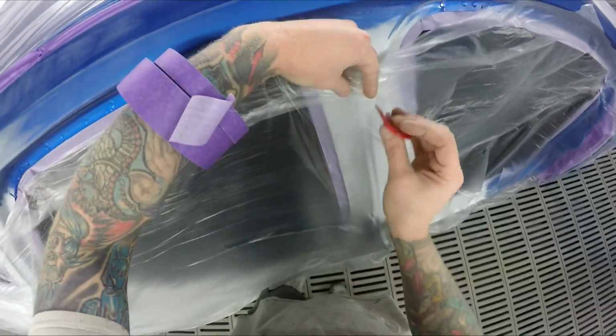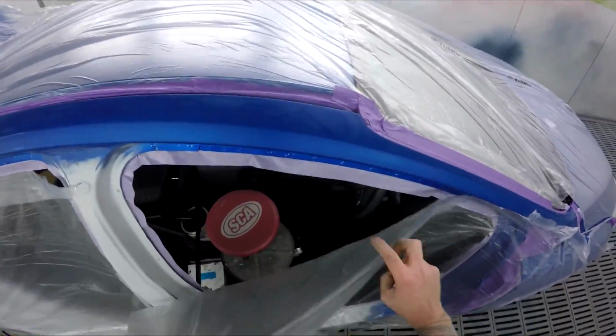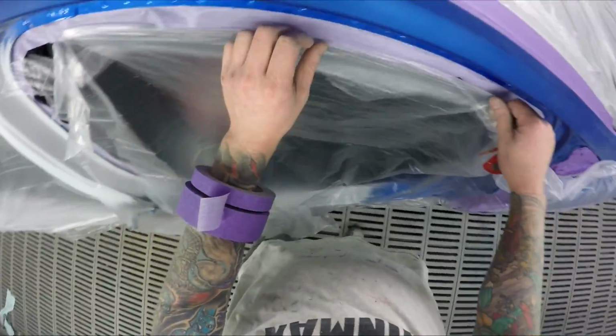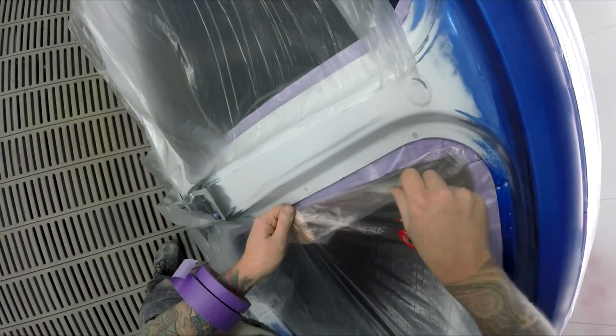This is also coated, it's got some corona treated, that's what it says on the box, but basically it's got a coating on the outside of this that makes it so that the paint sticks to it. If you get this upside down, you start spraying and all that paint will lift off. So yeah, be careful of that one. Either that or just use a bit of paper. If you're not sure that you got the good plastic, just use a piece of paper over the edges.